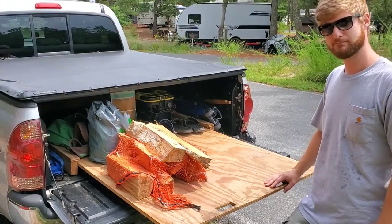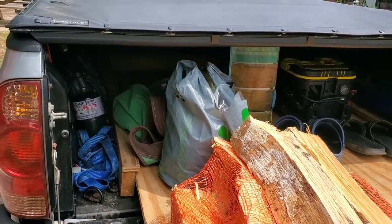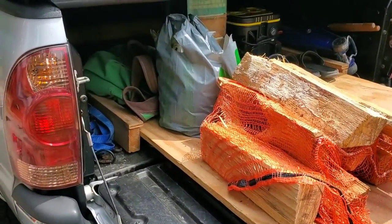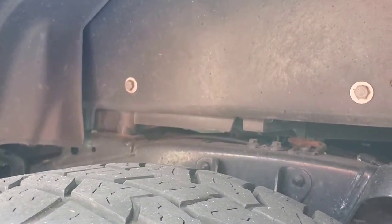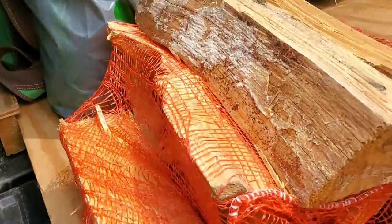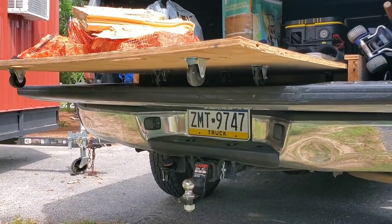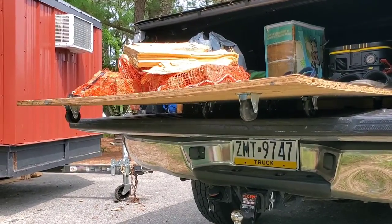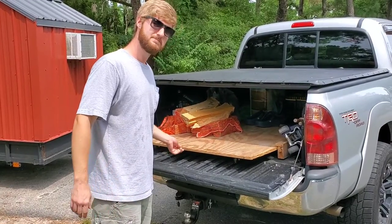The rails are bolted through the truck bed — two bolts in the fenders on both sides into the composite bed. You could easily do it with a metal bed as well. I got the idea from a co-worker who had built his own bed slide. The roller wheels are a really simple solution — you can get a bunch of wheels for next to nothing. The wheels were fairly inexpensive; the sheet of plywood costs more than anything these days.